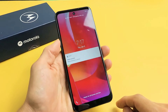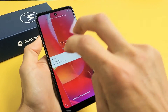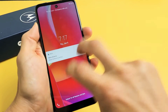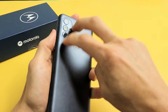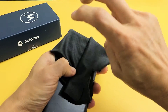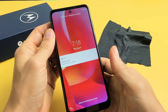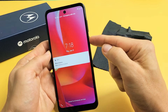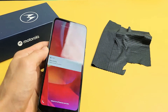Hold the phone and use two fingers to tap kind of hard on the screen all over. Sometimes as you're doing this, you'll get out of the boot loop. Keep going all over, same thing on the backside — give it nice hard taps, even on the camera lens. If you don't want to dirty up the camera lens, put a cloth on there. After tapping, turn it over. If still stuck, press and hold that power button; do not let go until you see the Motorola logo appear, then let go.